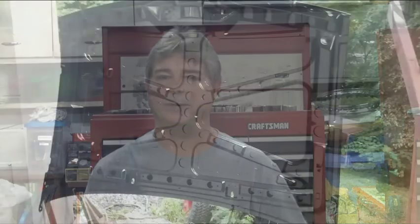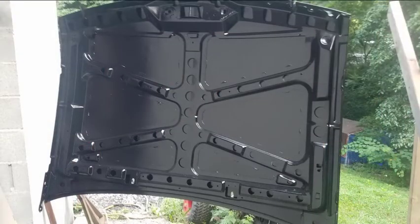He said they were having problems getting down painting it, which told me it was too thin. So when you want to paint a hood, just consider laying it down. If you want to do both sides, I understand, but there's no sense to get in a hurry. It's better to flip the hood upside down, shoot the underside with whatever you're going to paint it with, let it dry and cure out. Then the next day or two, flip it back over and shoot the hood normally.